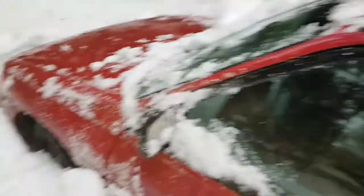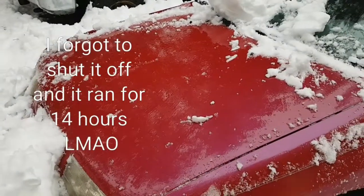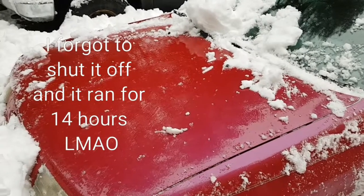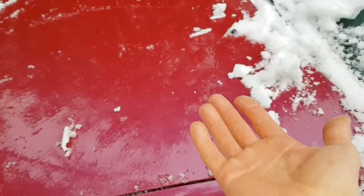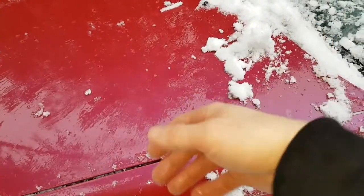But yeah, if you can pick one of these up, go for it. Like I said, stay away from the automatic transmissions unless you're 100% sure they've been maintained. About every 100,000 kilometers I would flush the transmission out, but eventually that automatic transmission is going to die and that engine is going to keep going. Five-speed is definitely the way to go. Working on the transmission on this, for another note, is stupid easy — pull the CV on this side, undo the engine mounts, put a block underneath, and you can pull it out by hand. It weighs like next to nothing. Pop the new one on — it's like an afternoon's job and you don't even need a hoist. It's fantastic.